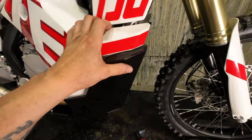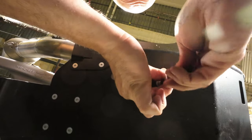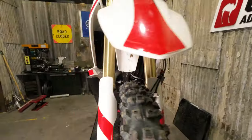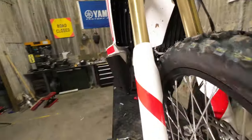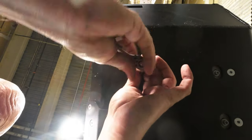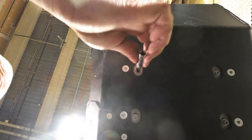The foam here is up against the tank, which helps to center the skid plate on the tank. Come down to the bottom. The foam does a pretty good job of centering the skid plate against the tank — just have a look and make sure both sides are about the same. Then we're going to come up to the front and tighten this upper bolt, then one by one pull them back out, add red Loctite, and put them back in.